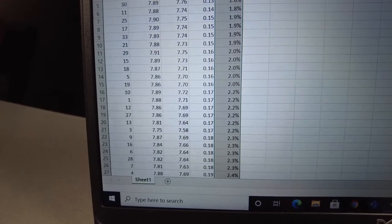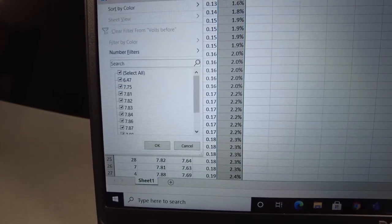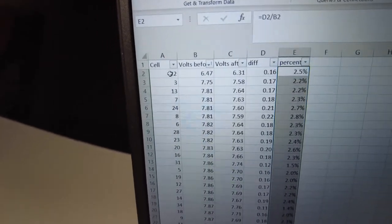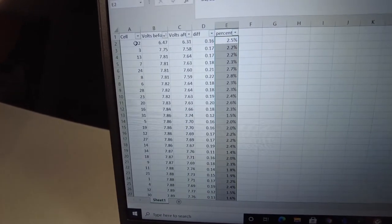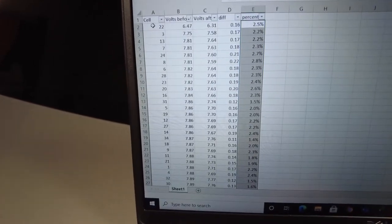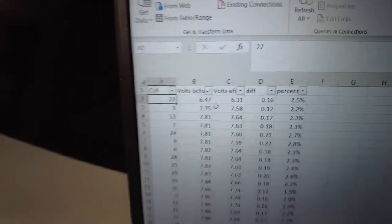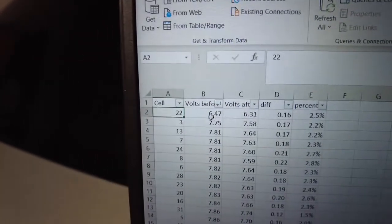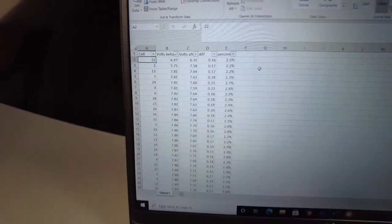Let's go back up here and filter it by the voltage, smallest to largest. Number 22 is the one that is the lowest on voltage. The batteries are supposed to be 7.6 volts, so I'll show it to you on my other screen whenever I go to look for new batteries, but it looks like 22 is the only one that's below 7.6. So I'm just gonna replace number 22 and see if the check engine and all those lights go away. The interesting thing is, even though it's a bad battery on voltage, it dropped 2.5% as well. So I'll see you soon.